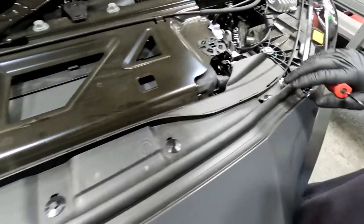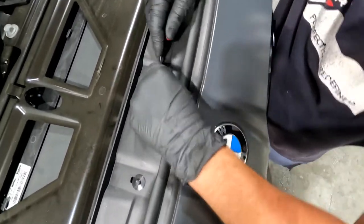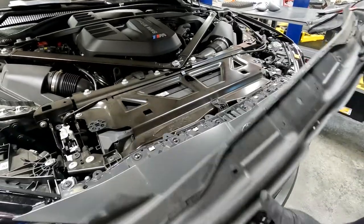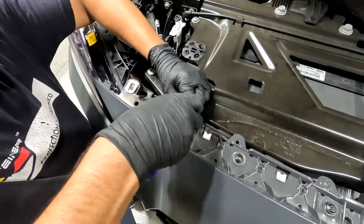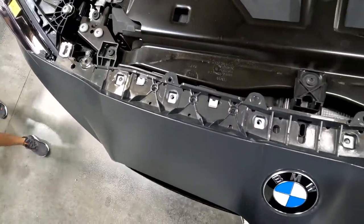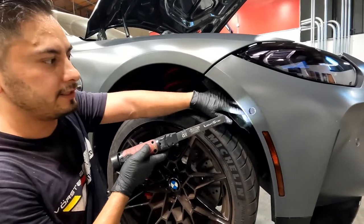We have this plastic piece covered, and we have these factory mounting points — all these out of the port. We have these bolts here, T30, attached to the bumper. We also have these two 8-millimeter bolts here. We have this connector, a sensor connector. We have another connector here — it's a sensor. And one more. So, we have three total connectors here to take this one out.